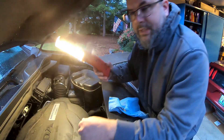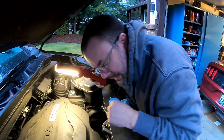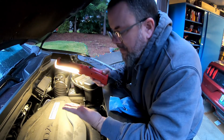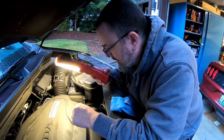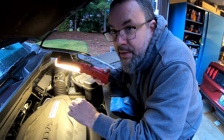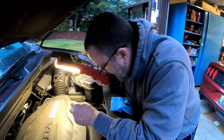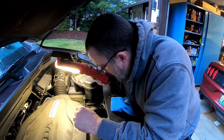So I'll get that squared away and we should be done with this. Any questions, you know where to put them. From here on out, like I said earlier, I probably won't change the filter ever again, but if we're going to be towing the trailer with this Honda, I'll probably change the transmission fluid once a year — it's easy and it's not that expensive. Hopefully this helps. I didn't see any other videos on changing that filter, so I wanted to do a video on it even more so than the fluid, since I think there are a few other videos out there on changing the transmission fluid. Thanks for watching.